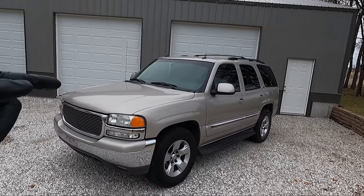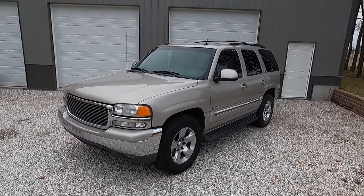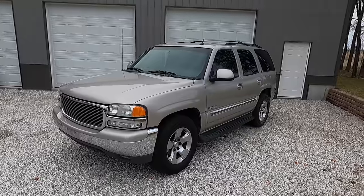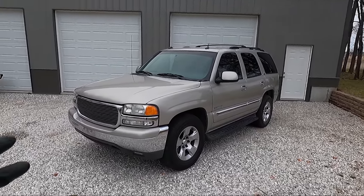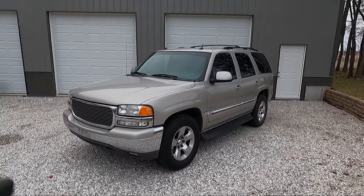The 54, the guy did tell me that he had a brake booster on it, and he switched to that hydro boost, and it made a huge difference. So the 54 also has a hydro boost on it, but I've had them without it. Like my green truck doesn't have hydro boost, and it seems to stop great. But either way, a lot of times if it doesn't see the right amount of vacuum, you get that error, the service brake booster error.